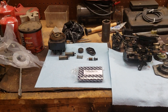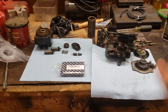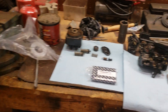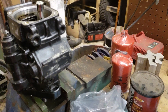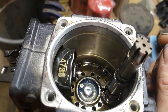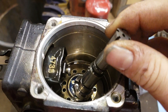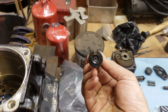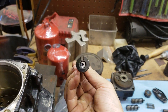I've got it pulled apart here and I wanted to show you some of the guts of this thing, because if you go to do the same thing, you may pull it apart and drop stuff everywhere like I did. The VE is a rotary pump — it distributes fuel by turning a piston. This is your rotor. Your rotor sits down in here. If you see that slot there, it locates itself on that pin up there in the corner. It rides on that right there in that little hole, and pretty sure fuel goes through there.